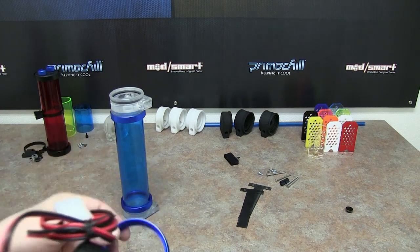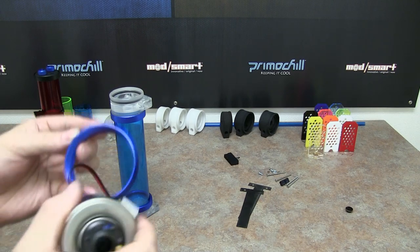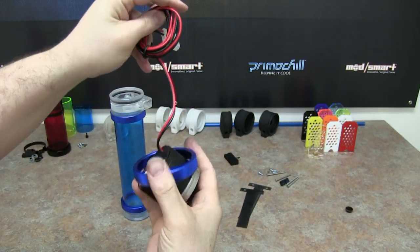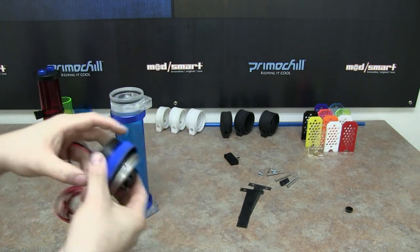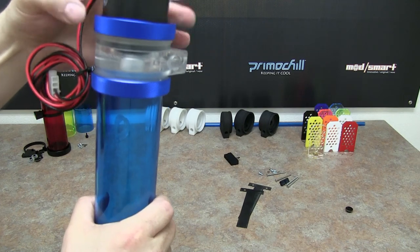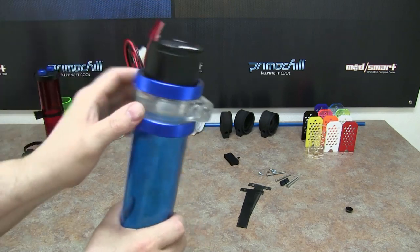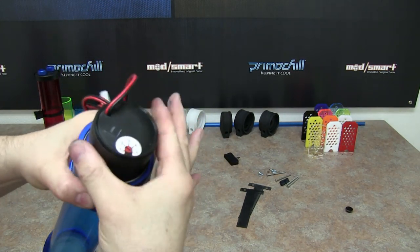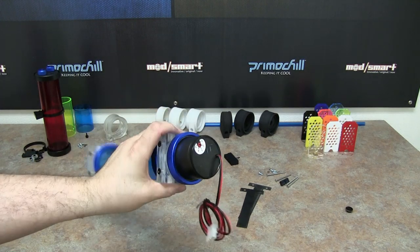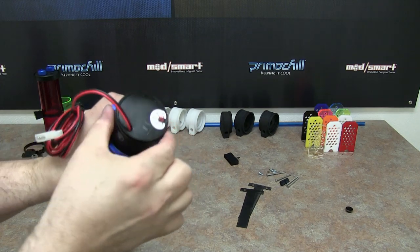To cover that quickly: you're going to have the D5 pump head here, then take the shim and lay it over on top of the other O-ring. The same ring works on both the pump side and the compression side. Basically, take your D5 pump, drop the wire through, slide your ring up, and drop the D5 head in there — give it a good force to make sure it's making contact. Then spin this on until it's nice and snug. You can tell how snug it is if this motor turns or not — if the motor doesn't turn, it's plenty snug enough.